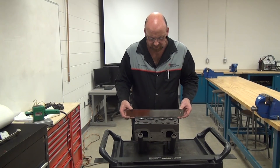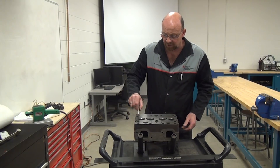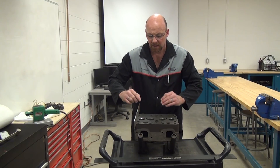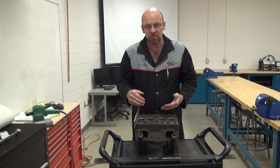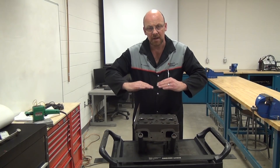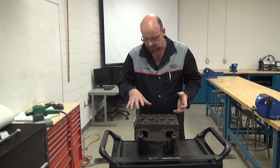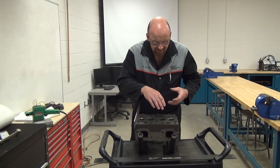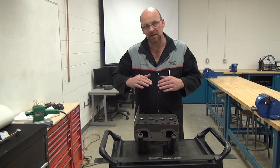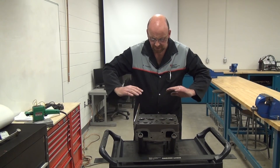We're going to place the straight edge just before the valves, after the valves, and move across the deck in a linear fashion — and then we're going to move and go across. Going in one direction checks for bend; going the other way checks for twist. Based on losing the torque on a cylinder head and being subjected to operating and ambient temperatures, the head can twist. Who knows how long it's been running loose, maybe it was over-torqued, not torqued enough, or maybe somebody missed part of the torque pattern. There are all sorts of factors that can cause distortion in service.